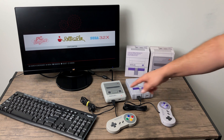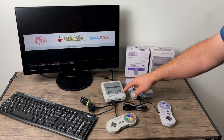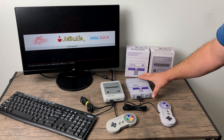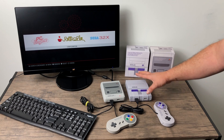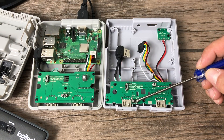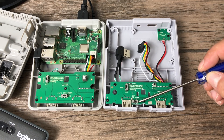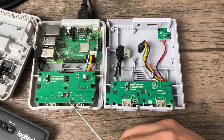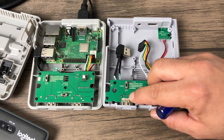In order for this to work your Raspberry Pi will need to be connected online either by ethernet or wi-fi. We're going to connect to RetroFlag's GitHub, download their script, and it's automatically going to install it for us. You will also need to make sure that inside of your RetroFlag case the Safe Shutdown switch is turned to on. The one on the right is the SNES version, the one on the left is the Super Famicom version. The switch is right here — there's an on and off label. Make sure it is set to on if you want to use this script properly.